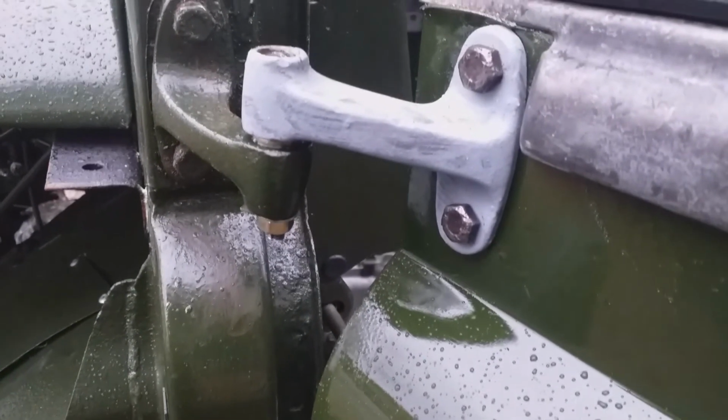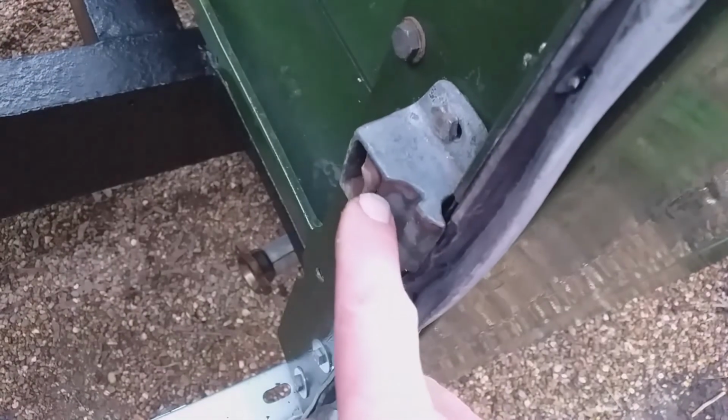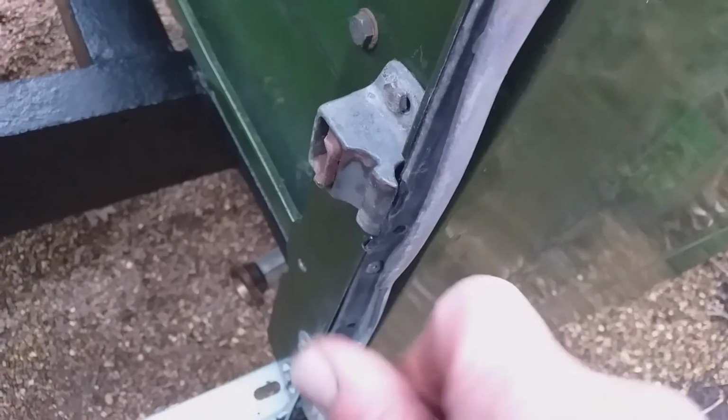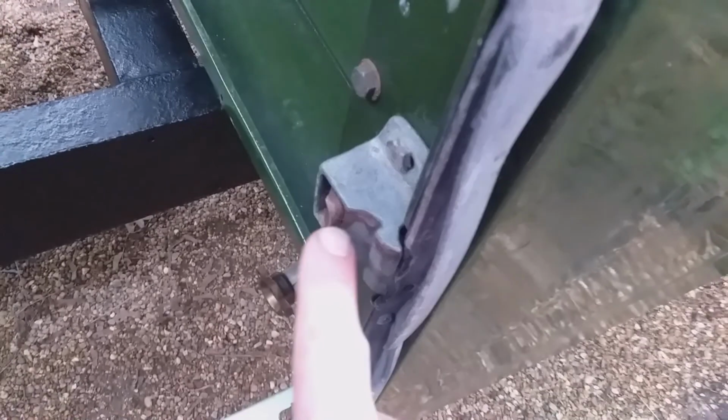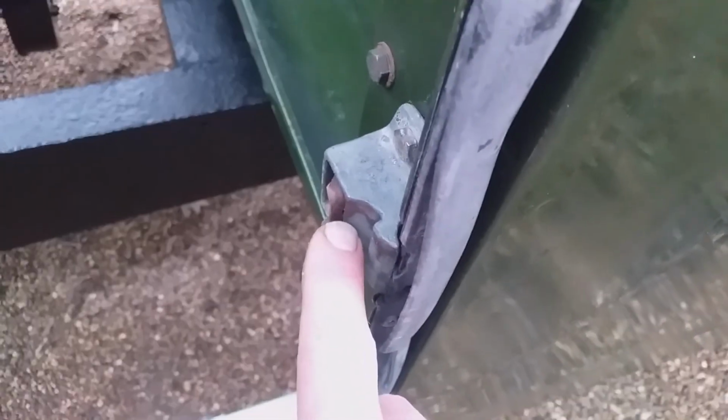Alright, the hinges, oh, they're not painted. Well, it always takes a little bit of fettling, and this one is no different. It took some fettling, and I sort of painted it up. I've got a door top on there, and I put the check strap in there. My striker plate had this weird thing in it. It's not a normal striker plate, and it used to have a really massive door gap, and this striker had an extension on it because of the rubbish door gap. Because the door gap's better, I've had to cut that down a bit. Shouldn't even have it on there anyway.